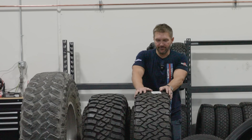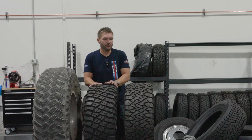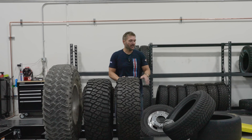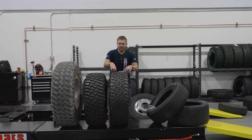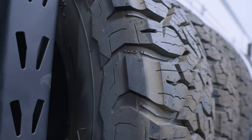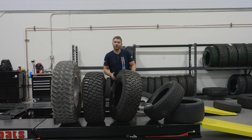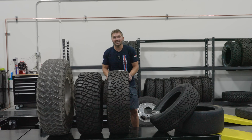Now for what you've probably been waiting for — off-roading tires. You'll typically be deciding between something like this: a BF Goodrich KO3, which is an all-terrain tire, versus the KM3 — I believe the M stands for mud — which is a mud terrain. All-terrain, as the name implies, is meant to be a hybrid. Instead of being a slick or having only sipes and small channels for water, it's got those, but it's also got big tread blocks and, for the first time, tread blocks along the outside edge of the tire. These side blocks are going to become critical when we talk about contact patch in the next video.